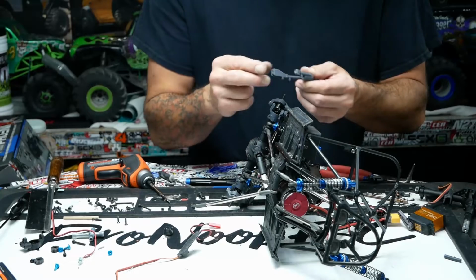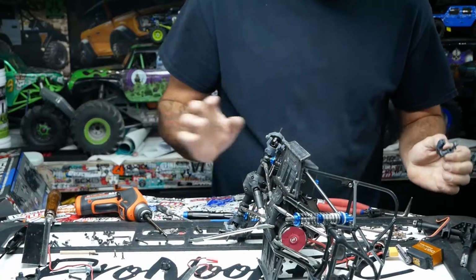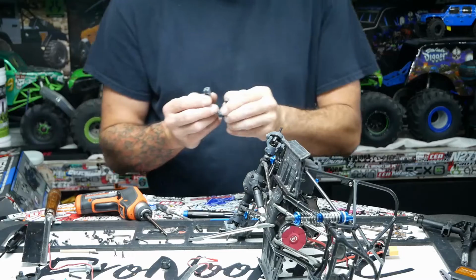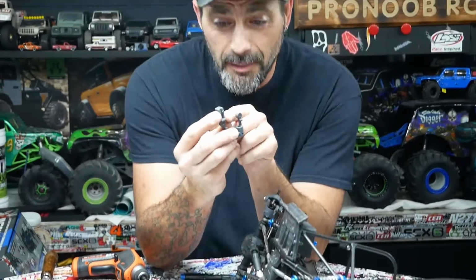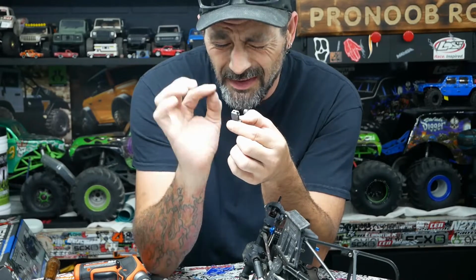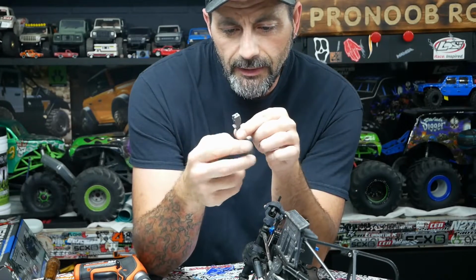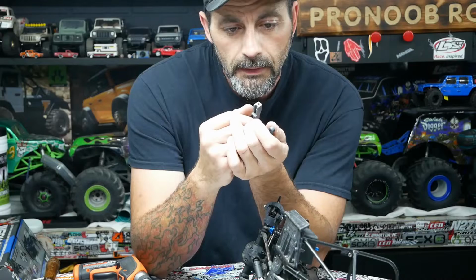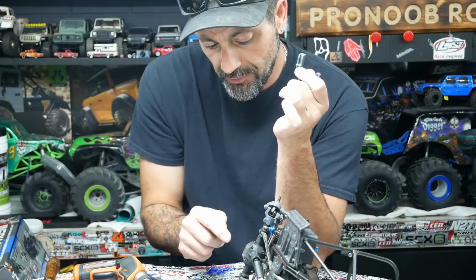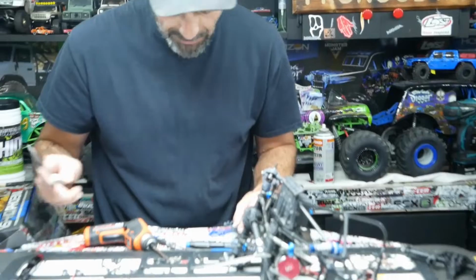Okay, so for the upper Panhard mount, we're going to switch over to our hard plastic one. We did a couple test runs with the soft one, and it's now garbage because that's not going to work. So we're going to trim this guy down. We've got him measured out here at 5 millimeters. We're going to knock him down 5 mil off the bottom. That's going to get us a little bit more up travel, not as much as we wanted. We'd like no interference, but we might be able to space the lower link out a little bit from the pumpkin and such too. So anyhow, we're going to get this cut and then we'll dive into that. Let's get down this path before we get to the next one.